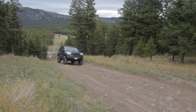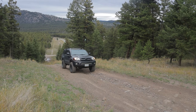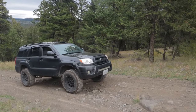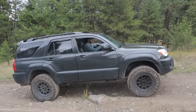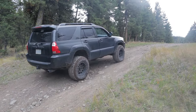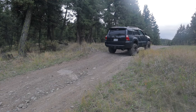Compared to the stock suspension — and keep in mind this 4Runner had the rear air suspension from the factory and the X-REAS setup — these offer a much smoother ride overall. It's stiffer and a bit more firm, but it's much more compliant over bumps, especially large sharp bumps. The 285 tires help a little with that too with the sidewall, but it's almost confusing: it's smoother, yet you don't feel anything in the street anywhere near as much as you do with the stock setup.